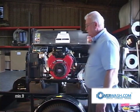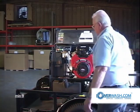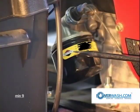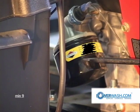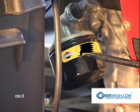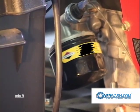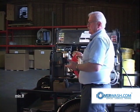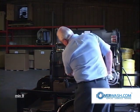To change your filter, you go to this side of the engine. Right down here is your engine oil filter — it's screwed on there hand tight. You should be able to reach around there once you've drained your oil, unscrew the filter, get your new filter, lubricate the seal on the top of the filter by dipping your finger in oil and lubricating it, then screw it back on hand tight.